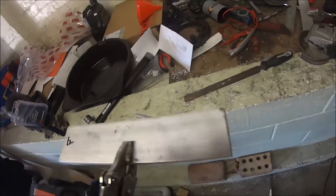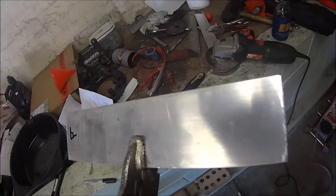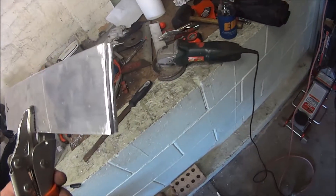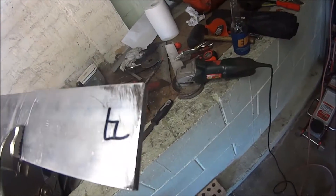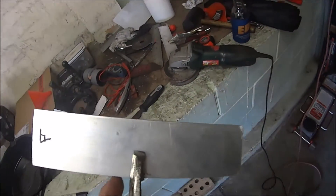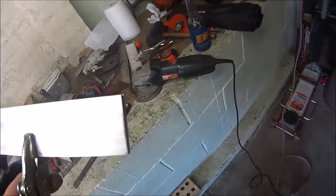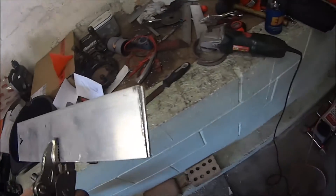Here's a little trick - well, not really a trick, just a little bit of common sense. These aren't cut perfectly square and equal - see that end's not quite right, but this end is square. So instead of spending ages worrying about that tiny little amount of out-of-squareness at one end, I've marked the same end as square on both pieces. From here on in when I'm working, I'll always work from that end, and it'll be the same end on both, so all my relative markings and distances will be the same despite this end being wrong - because it doesn't matter in this instance, the end's just going to poke out the end.